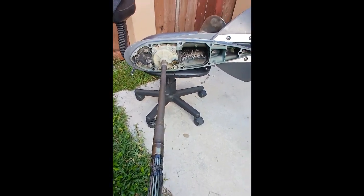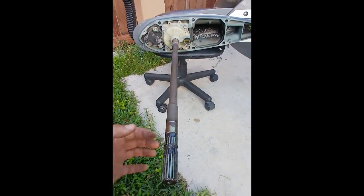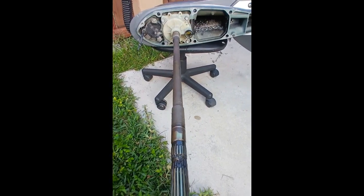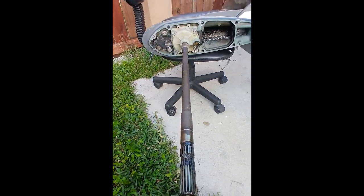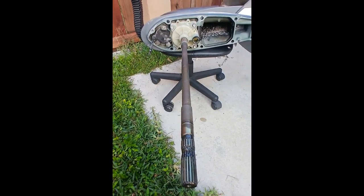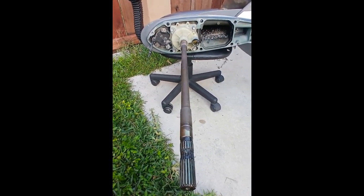So you've got to take it down and lubricate that shaft, clean it, get the old grease out and put new grease in it. I'm going to use the marine blue one, and that should stop that squealing whenever you're in idle or running at a low RPM — it'll start squealing on you like a little rat, like a little mouse.